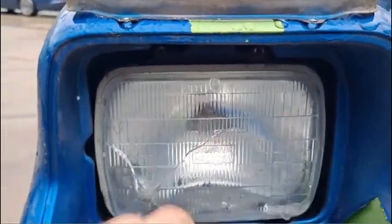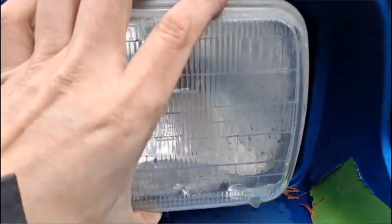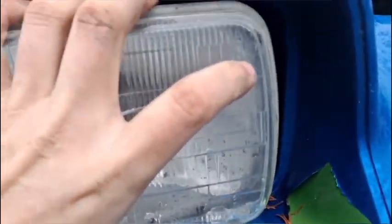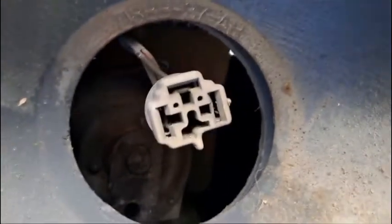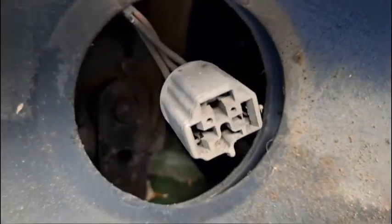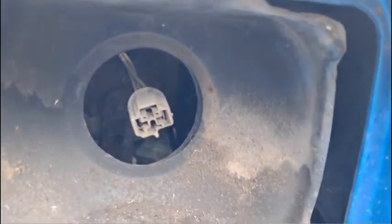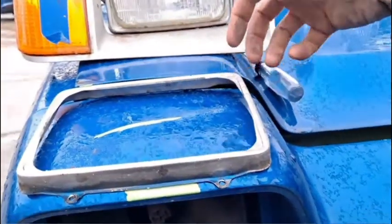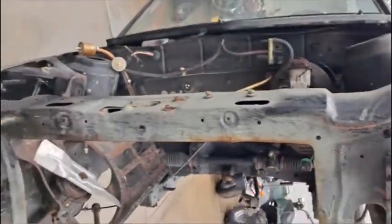We'll set down the steel wool and grab the headlight bucket. At this point it might try to fall out — the only thing holding it in now is the three-prong electrical connector on the back side. So if you pull it with a firm grip, pulling straight and true, it comes straight off the connector. Otherwise, you can reach inside under the hood and pull it out by hand. On the left it's right next to the horn; over on the driver's side it'll be right by the battery. Whether you have an Escort or EXP, there is plenty of space to reach down in there, and there's actually a big oval cutout to fit your hand in and unplug it.